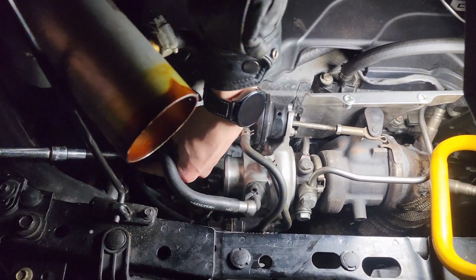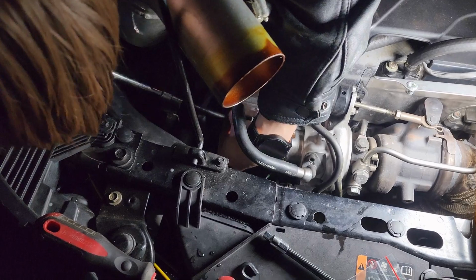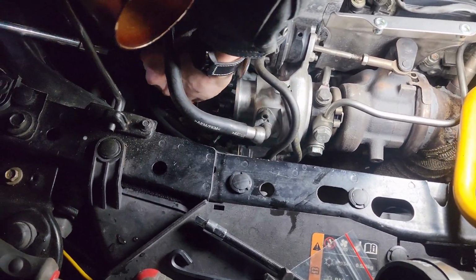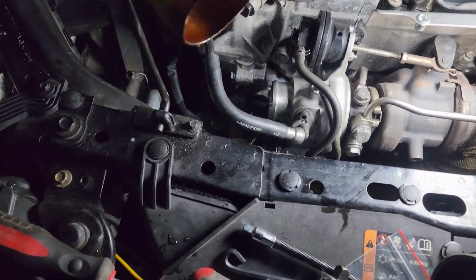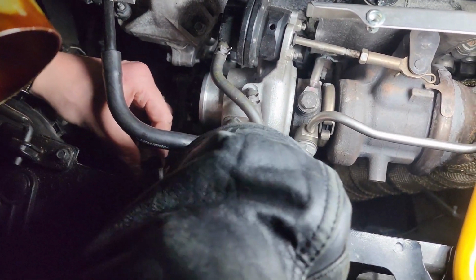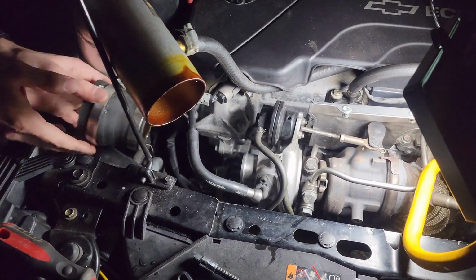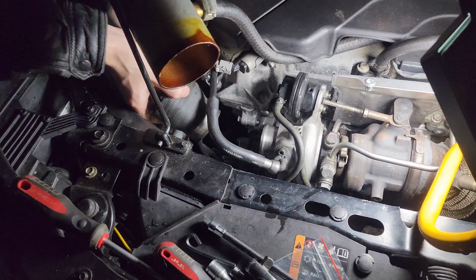And we're back. So, fair warning, the bottom bolt on this, when you do the aftermarket bypass valve, is going to be a nightmare to put on. So just be prepared for many, many different tools to make that happen. And now it's on. Seems good. So then there's just one connector that should be identical. Yep. Imagine if it's not. But it is. Hey, look at that. That can just be tucked out of the way. And now that's connected. Now you just reassemble, put your intake back on, and then you're good to go. We'll do some testing and get some audio clips here in a minute.